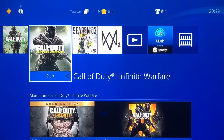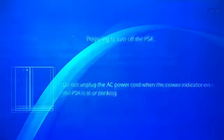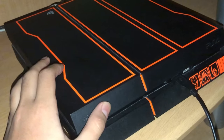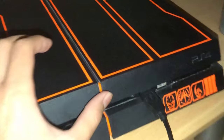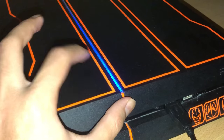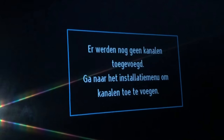I'm gonna show you the fixes. First, turn off your PlayStation 4. By the way, if you have the unrecognized disc issue, you will get a question mark on the disc once you try to start it. Once it's turned off, wait till the white light goes away, then hold the power button until you hear two beeps — that's the first beep, then the second beep — and leave it like that. You should now see something on your screen.